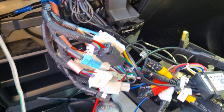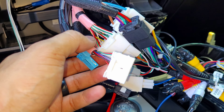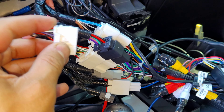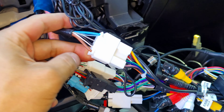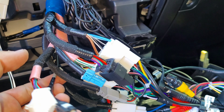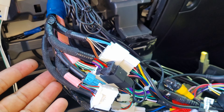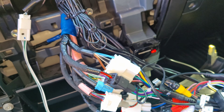Just go ahead and remove the wiring harness for the hazard from the factory unit and you should be good. Another tip: I made the mistake of plugging this part into the wrong plug — they are the same connector. The one with the brown and blue wires is what goes here, as it matches the power. That's why it wouldn't power up the first time. Since this unit didn't come with instructions, I had to figure it out on my own.